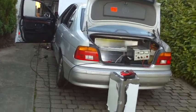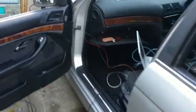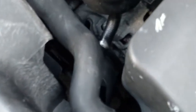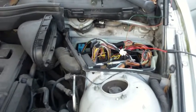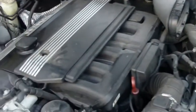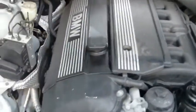Welcome to the EV Lab on a nice sunny Saturday morning. We've been doing some experimentations and as you can hopefully hear, those injectors are firing away in there and coil packs firing, even though if we look down here the engine is stopped. That's because we've gone into the DME and fed it a false crankshaft position sensor signal which has convinced it that the crankshaft is turning, so it's firing its fuel injectors, coil packs, and adjusting all the things it would normally do even though the engine is stationary.